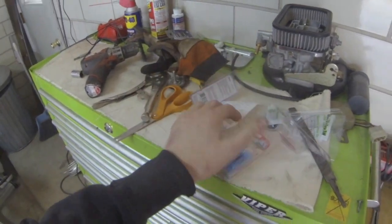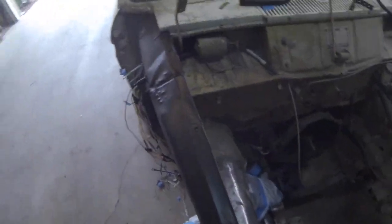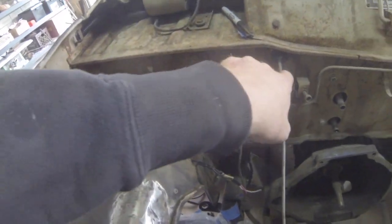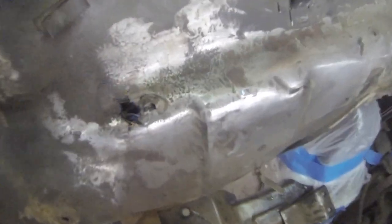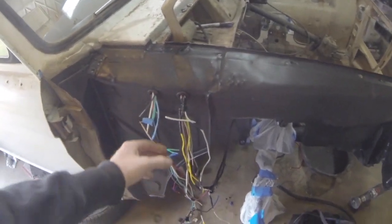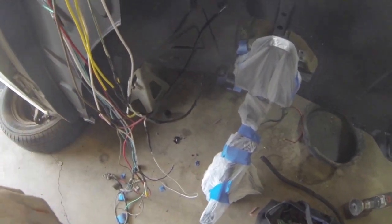Back from AutoZone - I had to run and get a couple of these butt connectors. I needed some of these bigger ones to help me with my wire tuck on the Datsun. It's a pretty simple car; I rewired it like last year and it was really messy. All of the wires come out of the firewall back there - they came down here, one went to the coil and the brake switch, and a bunch of it sat right here underneath the battery, which I got rid of. I'm going to relocate the battery to make it look a little cleaner. Now it's running through the side - I drilled some holes and put some grommets - and I'm running the two halves of the harness through there. Got to finish taping it up and make it look nice.